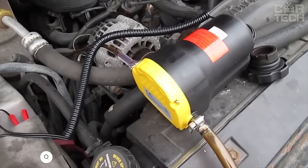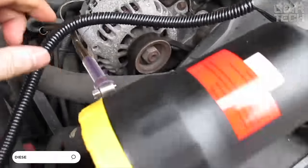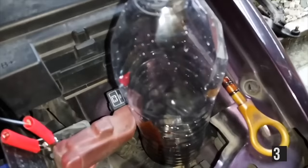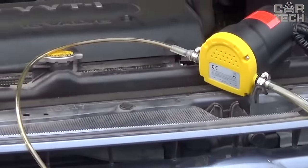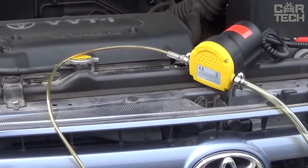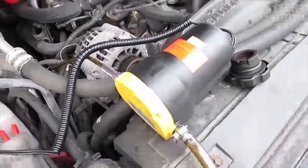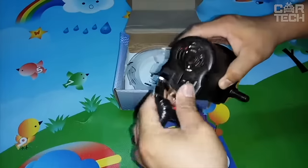The pump for pumping oil out of diesel engines allows you to significantly speed up repair work. Operating voltage is 12 or 24 volts. Pumped fluid volume is 3.2 GPM, sealed stainless steel housing. Please note — not for use with alcohol, gasoline, or other flammable liquids. When ordering, please ask the seller about the characteristics of the product you need. A choice of models is available.